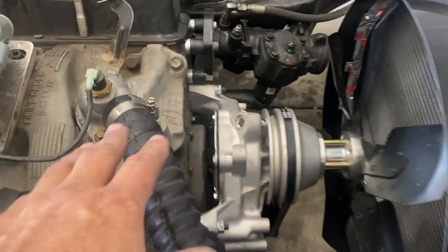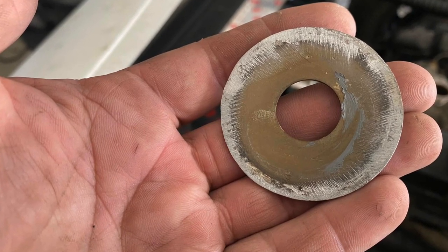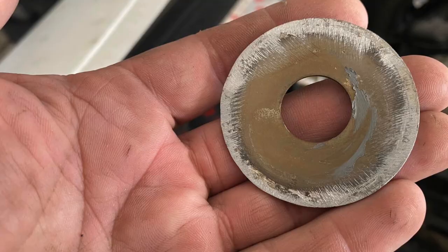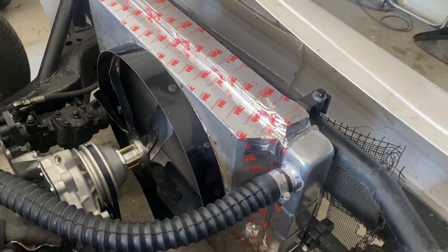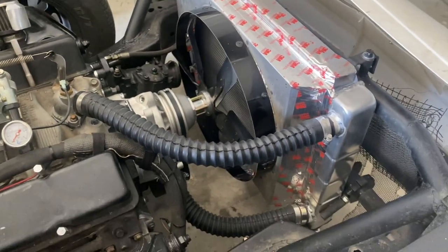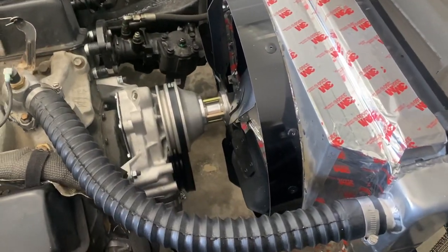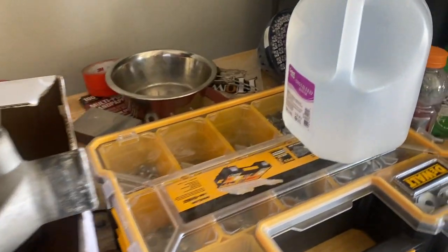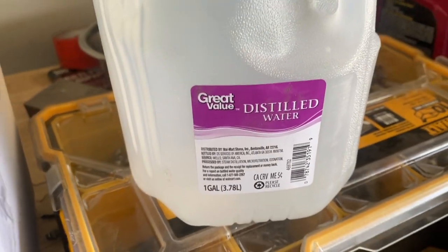One of the things we're going to do for the next race is get rid of the restrictor, because why would you want a restrictor in a race motor that's already restricting through the radiator? You're slowing it down. So: restrictor out, combined with a two-pass or three-pass radiator and a one-to-one pulley — that's a good way to start.